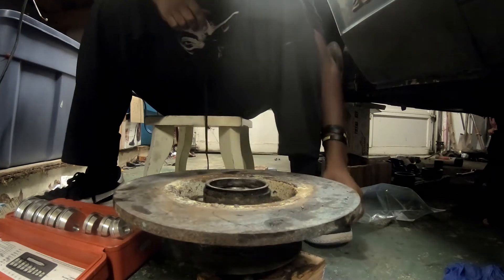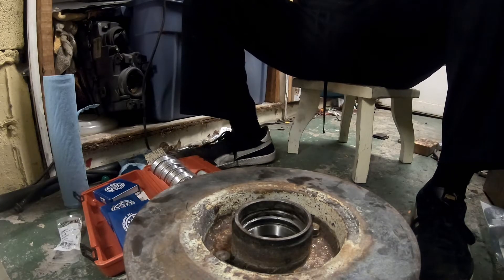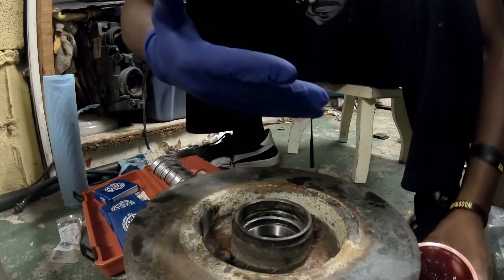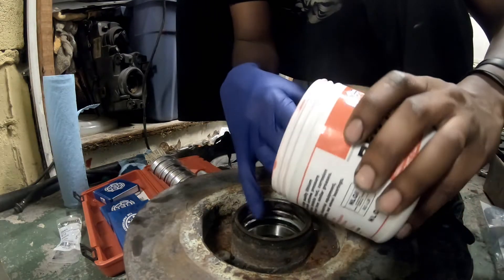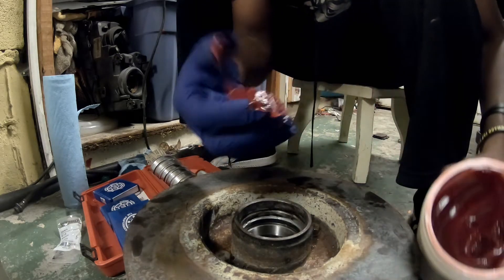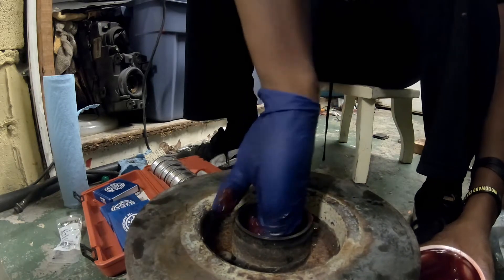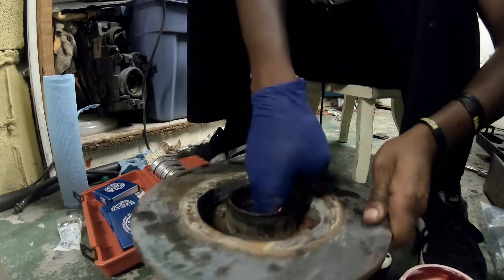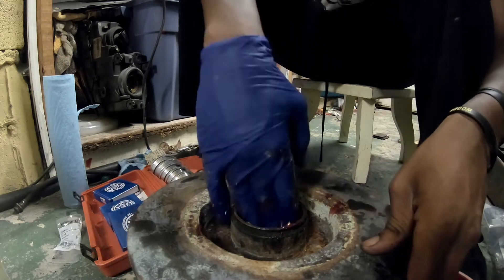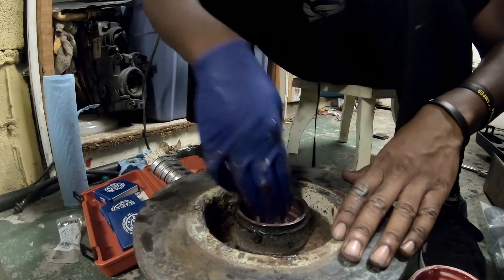That race is all the way in. Next is lubrication — we're going to be packing up our wheel hub with grease. Get a glove; dip your hand in there, get a nice scoop, and just put it all up in there. Get all that grease in — it's all good, it's healthy. Makes the wheel bearings nice and happy having all this grease in here. It's okay to get grease on your races; you'll be getting grease on them later on anyway.